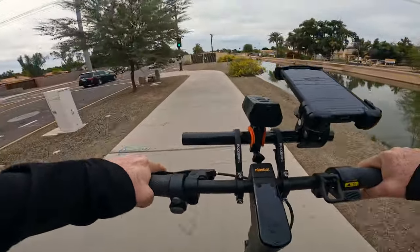We're at 19.4 miles with 24% battery remaining on the Ninebot Max, and we've already surpassed what we were able to do with the Apollo Go while still riding at 18 plus miles an hour — range is definitely the strong suit here. We are officially at 20 miles with approximately 20% battery remaining, which is when the battery indicator on the Ninebot Max G2 officially turns orange, and we can expect less motor output and slower top speed and acceleration.